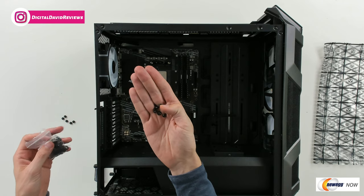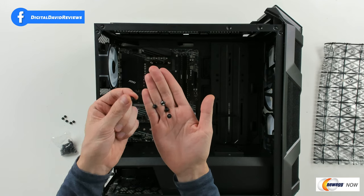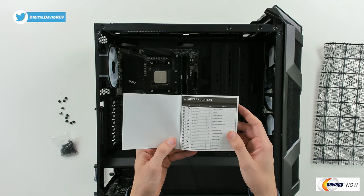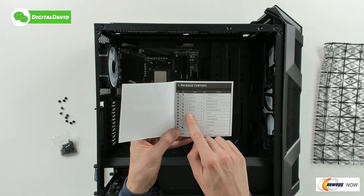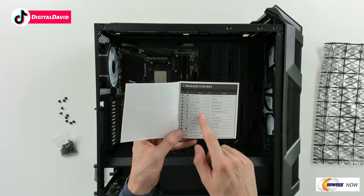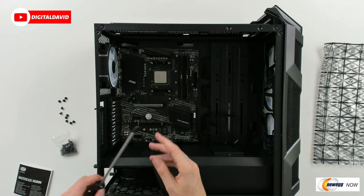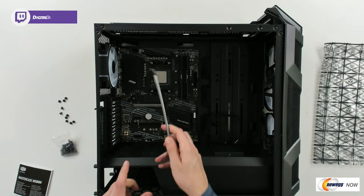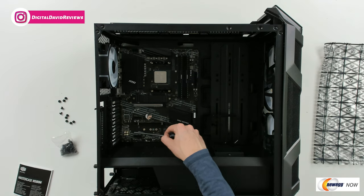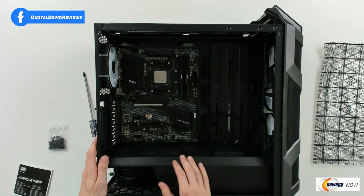They did provide motherboard screws for you — you can use those for the motherboard and the PSU. You can see them right here in the user guide. The screw we're going to use — there's 13 of them, so feel free to count them out. That's the screws you can use. So now take a Phillips head screwdriver — if you have one that's magnetized it'll make your life a little bit easier — and then place your screws wherever you have the holes in your board that line up with the standoff brackets. You can see we got all the screws installed and the motherboard fastened in place.